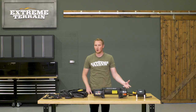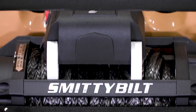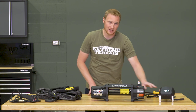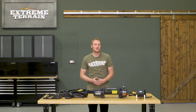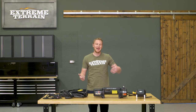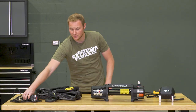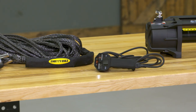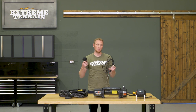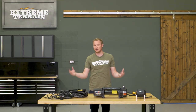If you wanted to get some longer wires, you could remote mount that solenoid box, but because it's waterproof, having it up on the front isn't really going to hurt anything. You have an on/off and wireless switch on the side of the solenoid box. This winch comes with two different controllers built into one. A lot of other winches with a wireless remote have a separate wired backup remote, so you have two to keep track of. What Smittybilt did is really nice — they built one remote that can be wireless when unplugged with a battery in it, so you can use it from a safe distance away. Or if you want to be wired, or if the batteries die, you can simply plug it into the cable and into the winch body and have a wired remote. You're really only keeping track of one remote instead of two, which is really nice.